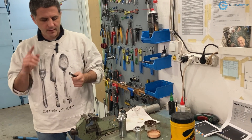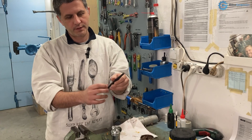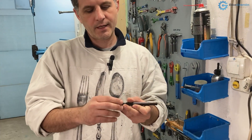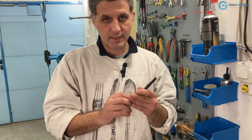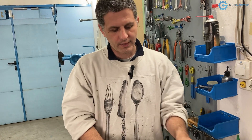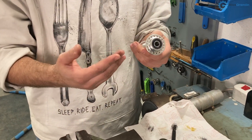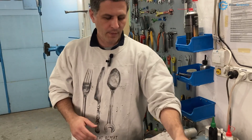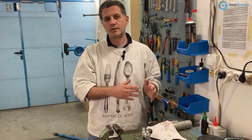When should you use mounting paste? Mounting paste should be used whenever you are screwing something in or mounting something. I like to smear it on the face of nuts when tightening to make sure you evenly apply torque, that nothing gets stuck, and that you can easily unscrew it when needed with no rusting together. For that I use anti-seize, while grease is used for lubricating things that move — like bearings. You should never use anti-seize on bearings, just as you should not use grease instead of mounting paste for mounting bolts, seat posts, stems, and so on. Many people swear by grease, but in my experience, grease does not provide the long-term protection from seizing that anti-seize mounting pastes do.